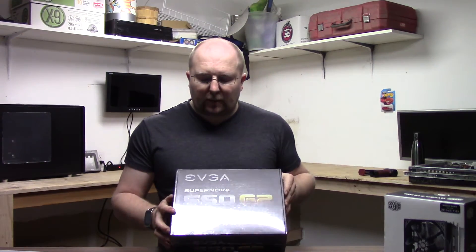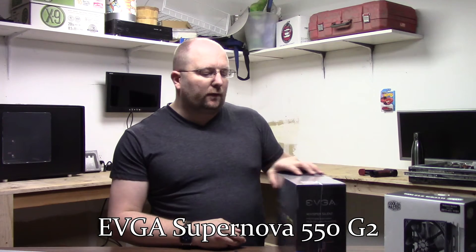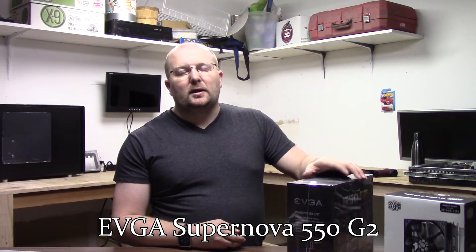For the power supply, I'm going with the EVGA 550-Watt G2 Supernova. I'm running the exact same power supply in my gaming machine — love it. Fully modular, keeps all my cabling cleaned up. I did a full build on PC Part Picker and it's only estimating that even with all eight of my drives, I'll be using about a little over 400 watts. So the 550 should be plenty, and gives me a little bit of overhead if I want to add anything else later on.